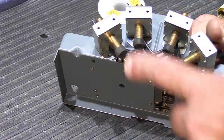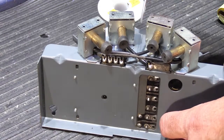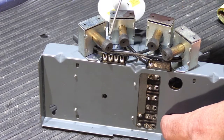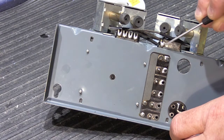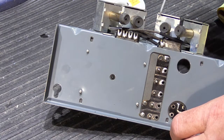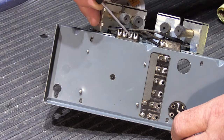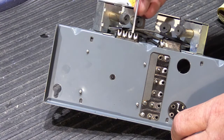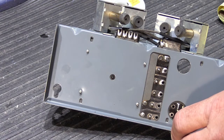The springs on an L model chime are shorter than on a K model chime, but they are the same diameter and the pitch of the coils is the same. For all of the speed and ease of assembling a chime on a circuit board, you still have individual wires from each solenoid that have to be routed around and soldered onto their proper connections. There's a common tab where one wire from each solenoid is soldered, and four individual connection points where the second wire from each solenoid is soldered onto its appropriate tab, so the chime sends power to the right solenoid at the right time.